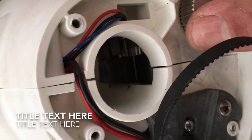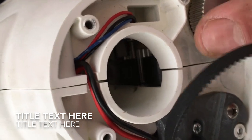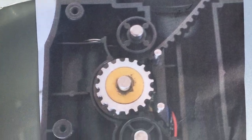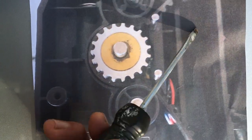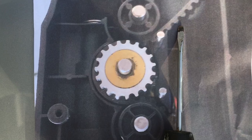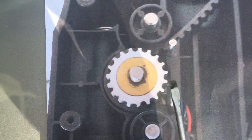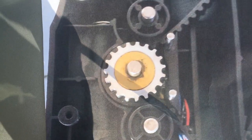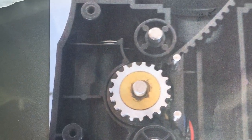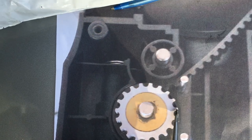So if you try to feed this belt by hand, you'll be here for two and a half days. Again, the hardest part about all of this is feeding it in. This is the shaft right in here, where the shaft goes through. The teeth face the shaft so that the smooth part is facing away from the shaft. I found it easier to load it from the top rather than the bottom, although theoretically it should be the same on both sides.